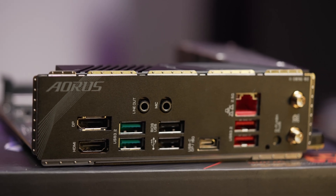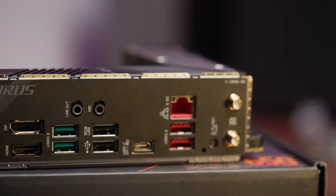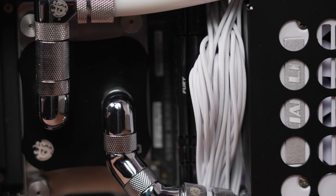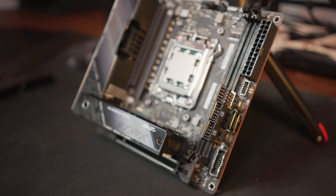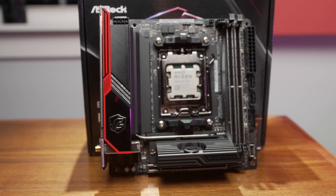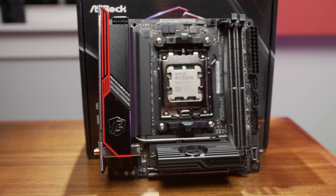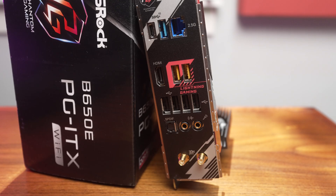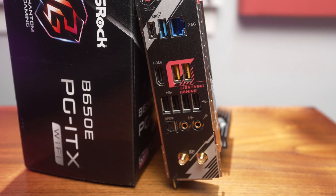With pricing in mind, here are the recommendations. Easy pass on the Gigabyte B650i — it has some good features, but the poor layout, no debug LED, and the need for an add-on card and dongles make it an easy out. The ASUS X670E also isn't recommended for most people — it's a solid board, but at a hefty cost with auxiliary components to deal with, the value just isn't there. The ASRock isn't a bad board and has some strong features like 2A fan headers, but it has quirks with the layout, the M.2 fan cable setup is a head-scratcher, and ASRock's BIOS frankly sucks. It also doesn't have enough high-speed rear ports — not a strong recommendation, though the price isn't too terrible.